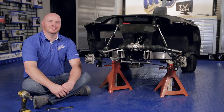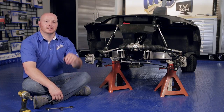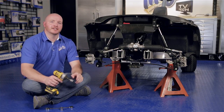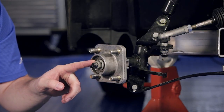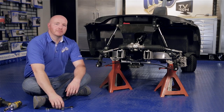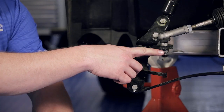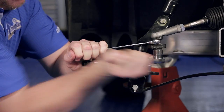To begin the installation we need to remove our front bumper. You'll also notice for video purposes we removed the front cowl. We're going to take a 13/16 socket and remove and retain the front hub and nut on the spindle. Then using an 18 millimeter socket and a 17 millimeter wrench we're going to remove and retain the nut on the bottom of the tie rod.